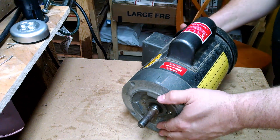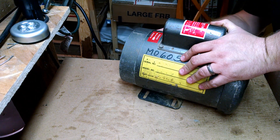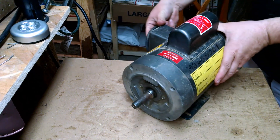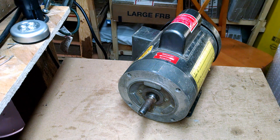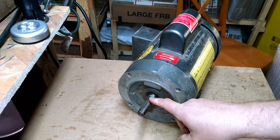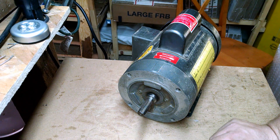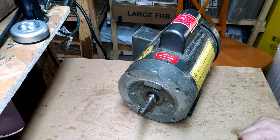Brakes work good and everything. This is a pretty fast motor here — it says CO 3509, 3450 RPMs on this one-horse motor. I'd say she works. That's quiet, that's good. Shuts down real fast and everything — good deal. There may be something else here where I see there's a little bit of damage in the keyway there, but it doesn't look like anything that's going to stop it from operating or from holding the pulley on there well.